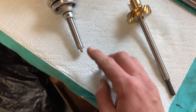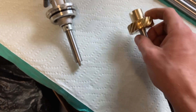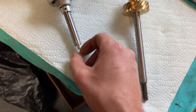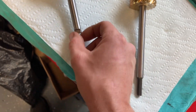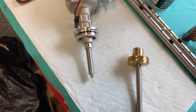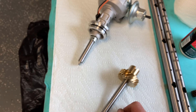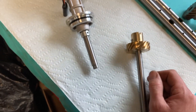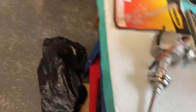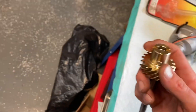My simple fix for that: I took my MIG welder and stacked a weld right there on the end of the shaft, and I bulged it out just a little. I pulled my intermediate shaft out, then took a flat file and filed it on both sides — tried to eyeball it, keep it even, didn't let it hang over the sides. I kept test fitting it into the end of the shaft, put it all back together, and it worked beautifully. The problem went away. So that may be something to think about if you're having issues like that in your old Mopar. If you've got an old stock distributor, that area in there could have worn out over years and years, just like inside the intermediate shaft. If you're doing a new engine build, consider a good high-quality intermediate shaft.